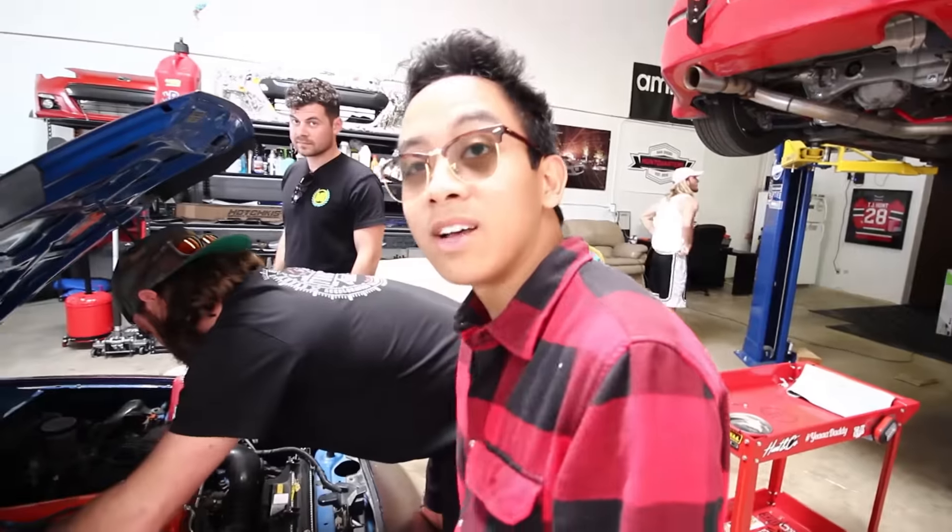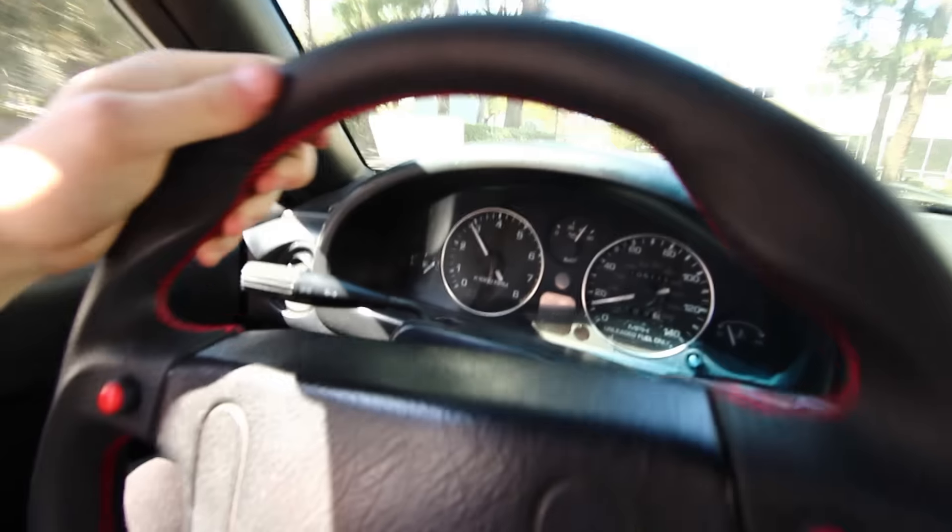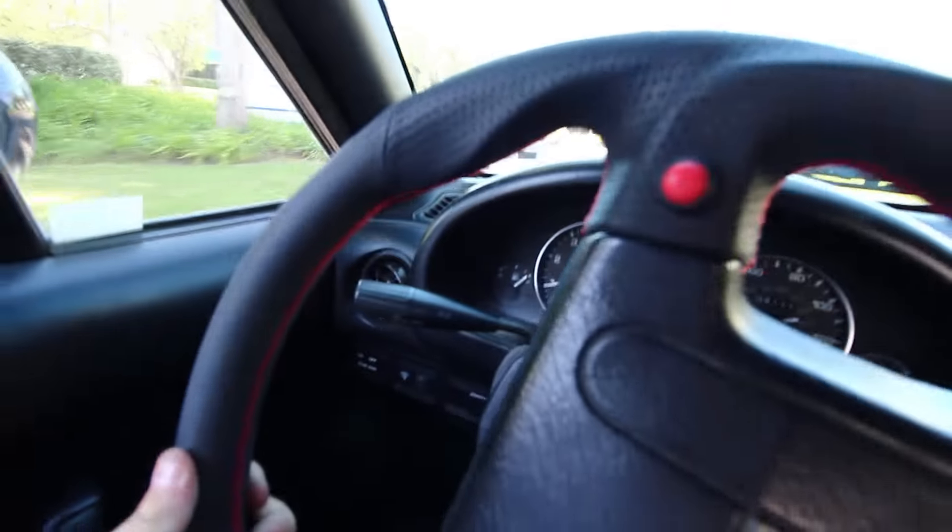That's awesome — you actually thought it was turboed. I was like, what do you think, we did that in 20 minutes? Right now we're going to go over the issue I have with the idle. It's when I push in the clutch after I start going, and it's not every time. It didn't happen there. It didn't show up on camera, but we were in the car and cleaning the idle control valve actually kind of fixed it a little. It happened a lot less frequently, and when it did happen it only went down to like 500 RPMs instead of 200. But it still did shake a tiny bit.